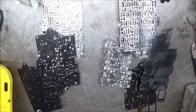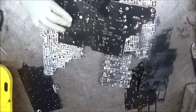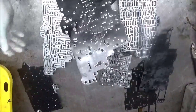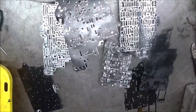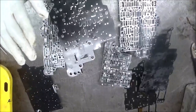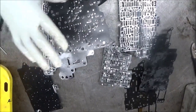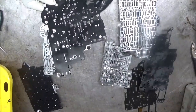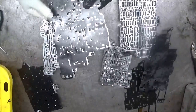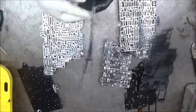We're going to put this gasket or valve body back together. This had a bonded gasket on it in the kit — you don't get bonded gaskets on a 4T65, the bonded gasket is still stuck on here. What I normally do is just put the gasket over top, and it'll work. But in this case it had broken a little bit, so I ended up sanding everything off and reusing the gaskets that were in the kit.